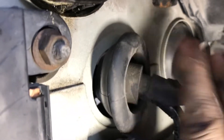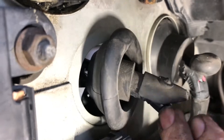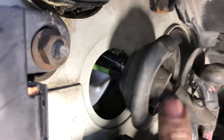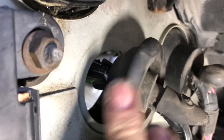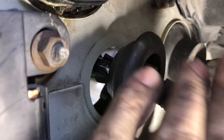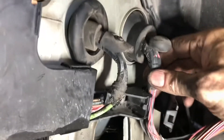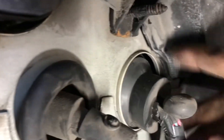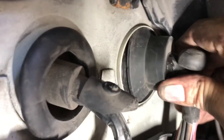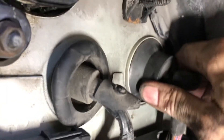I disconnected the connector on the inside of the car here - that just gives you a little bit more to work with. You can get this out and kind of clean the rubber piece up, clean up in here, because that's where that sealant is going to need to stick. On this one I just popped this little guy right here just to give myself a little bit of extra room. You can kind of push this in a little bit here and work on cleaning that up as well, because I'm going to put a little sealant in there to hopefully stop the leaks.